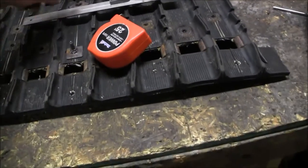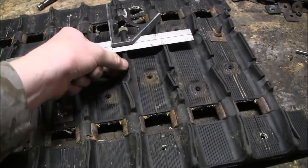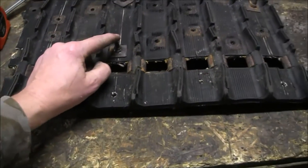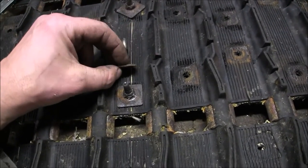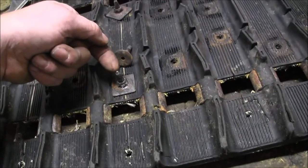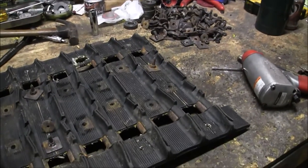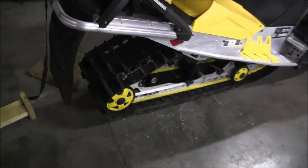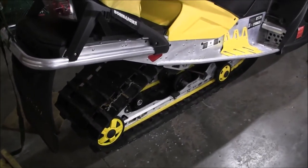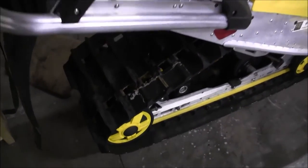This track is three-quarter inch high, so if you put a level across and measure up, it's three-quarter lugs. If you measure the studs from here up, it's an inch and an eighth. The actual height is an inch and a quarter, but once you put it in it's inch and an eighth. So this is a three-quarter lug track and I'm gonna pull the studs off to either reuse them or throw everything away. My sled is inch and an eighth lug, so the studs will be inch and a quarter going in but inch and an eighth after installed — the same height as my track.